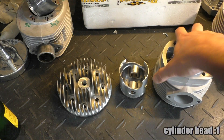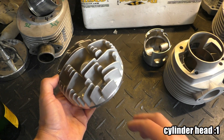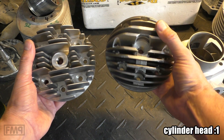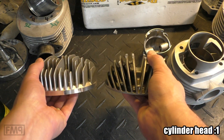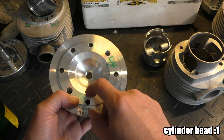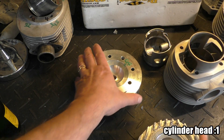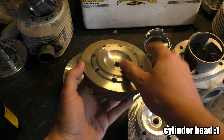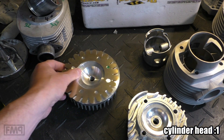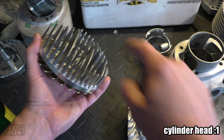Shall we start at the head? My question would be: why are there so few and little cooling ribs? I don't really understand. There are eight screws which are not needed, it's just optical. But it's the BFA 306 - you can also have eight screws with proper cooling wings. Having cooling ribs on the wings is of course quite important. And furthermore, why is there no seal ring? Look at the MRP head - it has a seal ring. Look at the BFA - it has a seal ring. No seal ring and using an additional head gasket. I get the idea that you have two little ribs here so you try to add some artificial ones, but this cannot replace good wings.